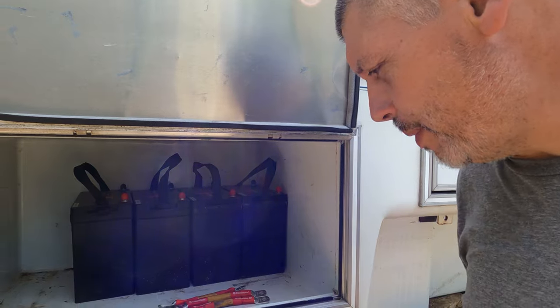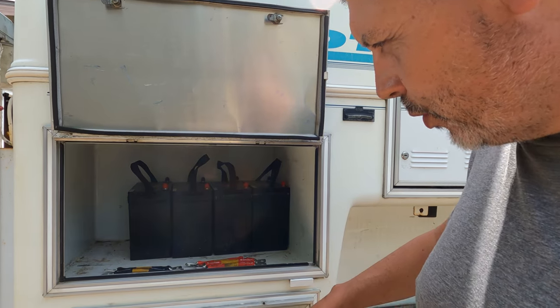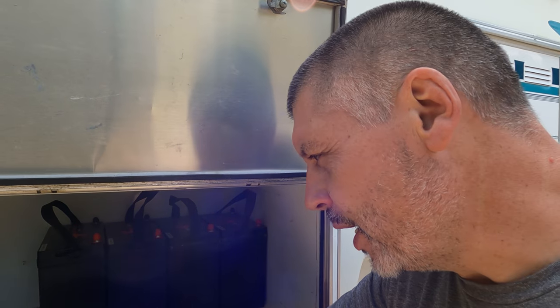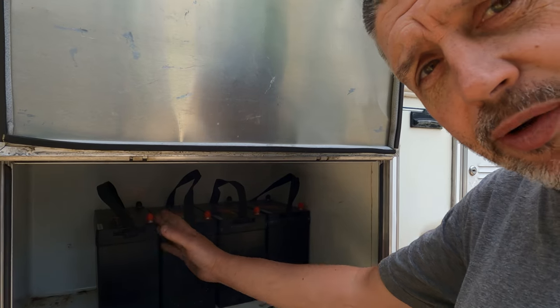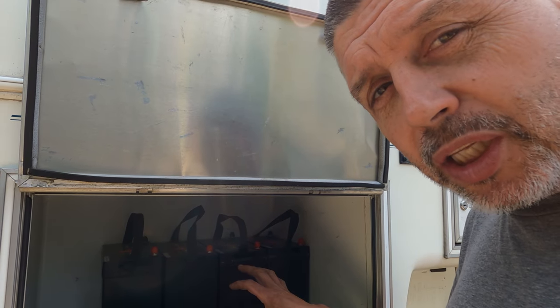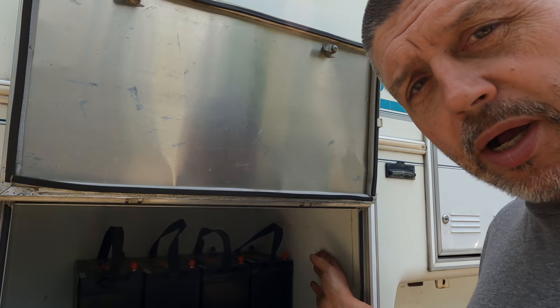Here's the plan for the battery and inverter compartment. The original battery compartment was down here — it had two group 24 deep cycles, which isn't really big enough to fit these four Li-Time Mini 100 amp hour batteries. They would just barely fit in there but then there's really not room for anything else. So I'm going to mount these batteries in this configuration and then put a removable panel in front of them. On that panel I'll mount the inverter, distribution blocks, and possibly the charger — or the charger could go in the kitchen cabinet on the other side.